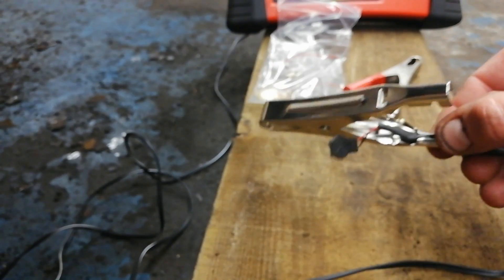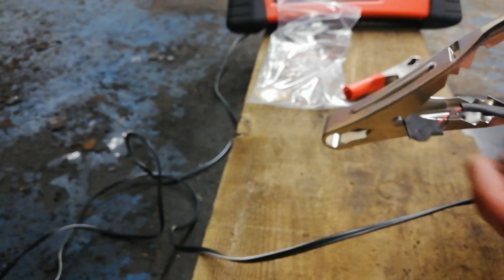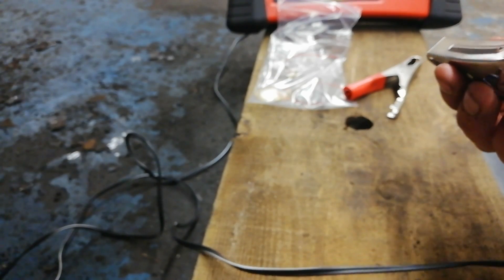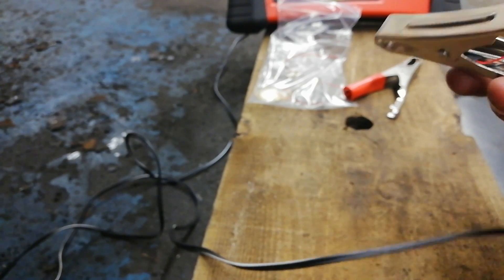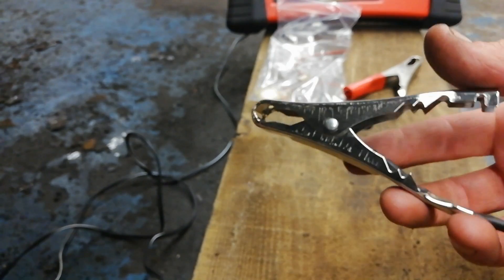The reason why I go for the small ones is they fit inside this crocodile clip. I have them connected there, and then what you do is you simply just sit it in underneath the spring - it just sits in there with a bit of heat shrink over the top of it. The heat shrink is just so the two contacts don't short out on the metal clip, so you can clip on to the roll bar or suspension or whatever.